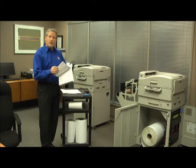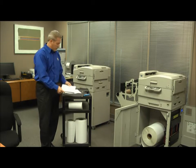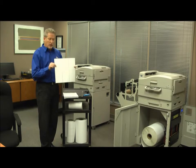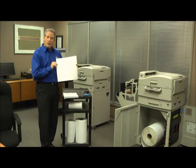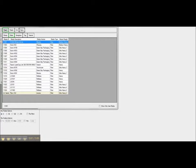When you do find the matching media — we want an exact match — you take that number and put it into the software. I've selected a certified media: just a plain, non-coated, matte paper. This one is certified media 11001 in our library. So now we've shown you the 4x6 3UP labels and we want to identify all the rest of the printer setups to accommodate this roll of media. We go through, select the media — paper, matte — and it takes me right to media type 11001.